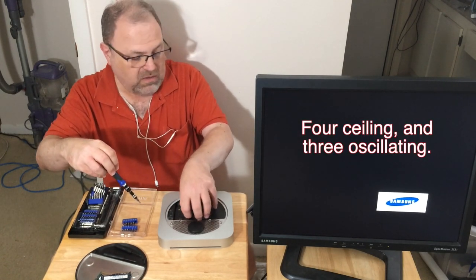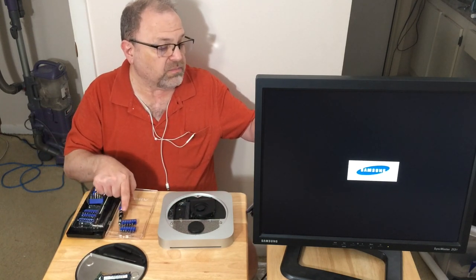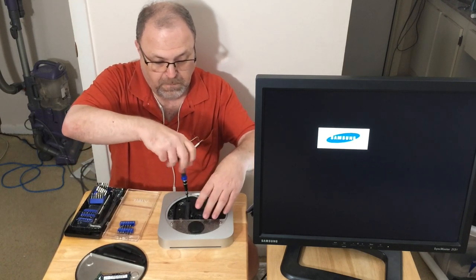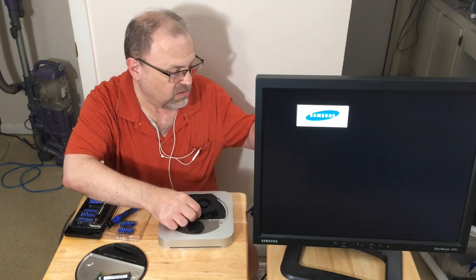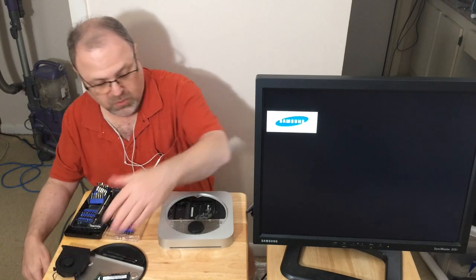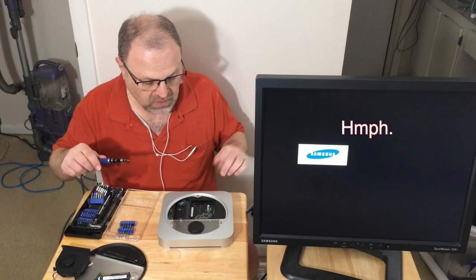Okay. There's actually 6 screws. What's this? Lift the ear. And yeah, T6 this as well out. Here we go. 3 screws. And carefully pull the fan cables upward to lift the fan connector. Remove the fan. Removed. I've done this kind of thing before on my other Mini. But, oh yeah, it was a little dusty too.